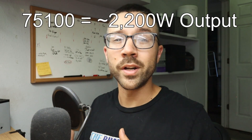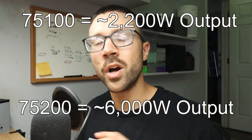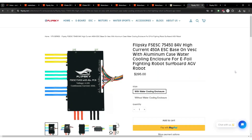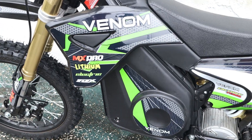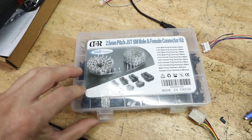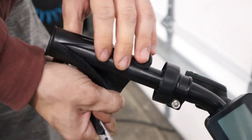Now let's talk about the performance once you get these controllers installed — you will not be disappointed if you purchase the right one. Make sure you have the right controller output for your application: for zero to 40 amps I'd say go for the 75/100; if you're looking to push something closer to 100 battery amps, go for the 75/200 series; and if you want to push even more, they have a 75/350. My main ride is a Mototech 1600-watt bike pushing 3000 watts of power with a 52-volt battery at 60 amps and 200 phase amps. I used to have it set at more phase amps, but the torque was almost uncontrollable. It's been really reliable — smooth power — and I have the Pro Series 75/200 controller with integrated Bluetooth so I've got the app to change settings on the fly.